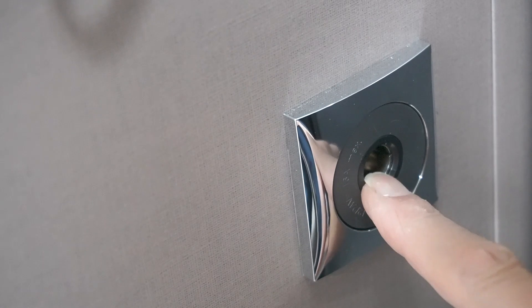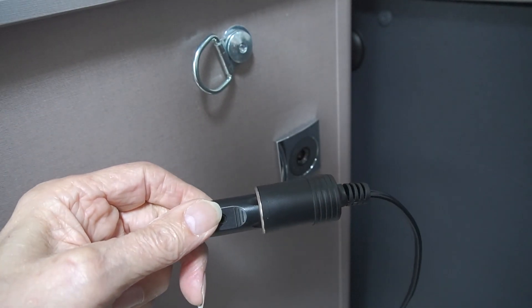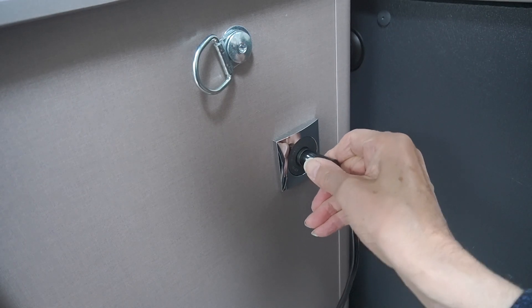One problem I had with this vehicle is I wanted to operate from the 12 volt supply, because the van has a separate 12 volt battery for use when you're parked up. It's got about four cigar sockets at various points in the van, but in actual fact they're not cigar sockets. They look initially like cigar sockets — they're called RV sockets, recreational vehicle, taken from the American term. You can't plug your cigar plug into these sockets without an adapter. Fortunately, the adapters are readily available. You can see here that I've got one — you get them for about five to seven pounds.